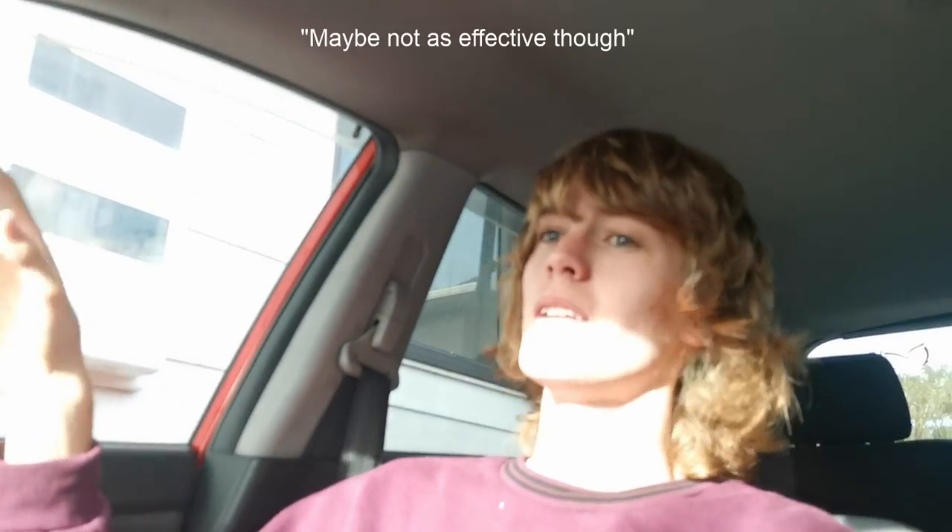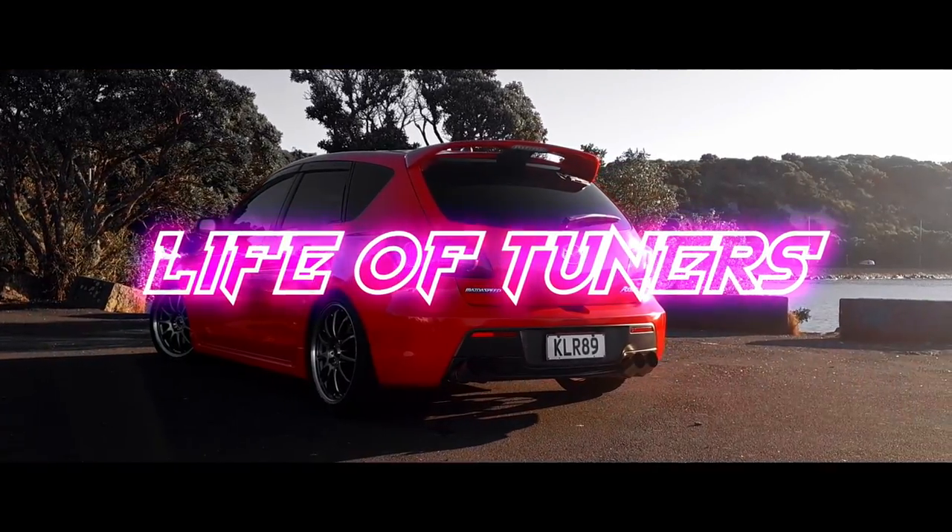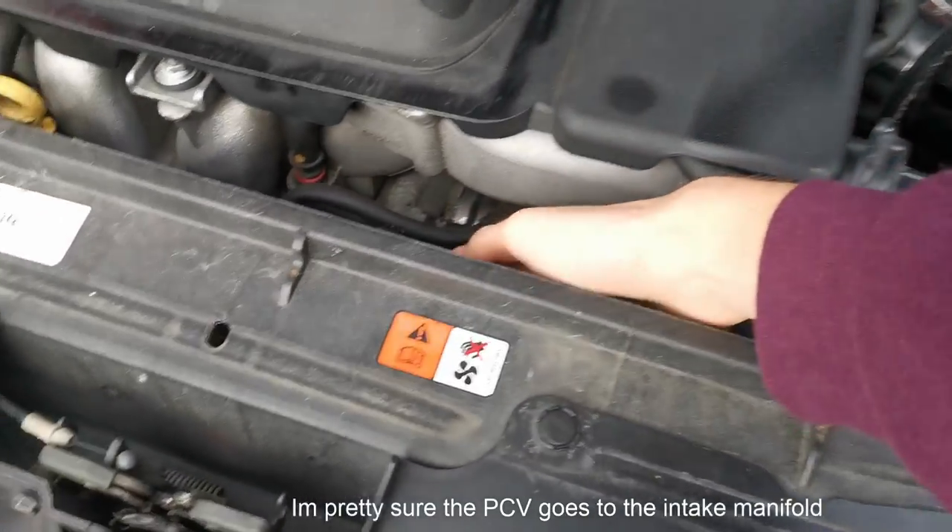After that we're going to be doing the big one — cleaning the intake valves. I'm not going to be doing the whole 'you need to take off the intake manifold and you need all these tools' thing. This is way easier and way cheaper. First thing: cleaning the throttle body. You have your EGR and your PCV system and that gets all this carbon and soot rerouted into your intake, which means your throttle body down here gets covered in all this carbon and soot.